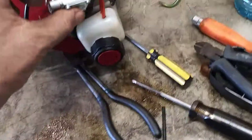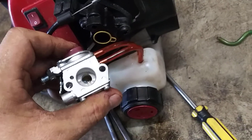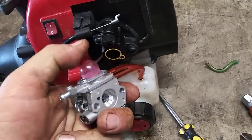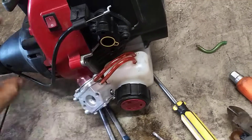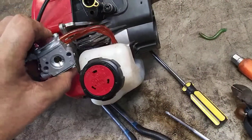So we're going to hook up our fuel lines on this and prime it to make sure we've got them hooked up right. And there it goes, it's primed up — you know you've got it right. If it doesn't prime up, tilt it on its side, open the gas cap, and see if you've got bubbles happening.